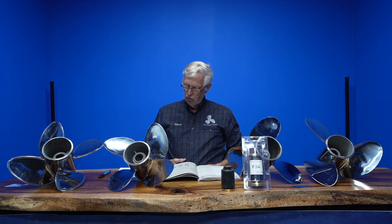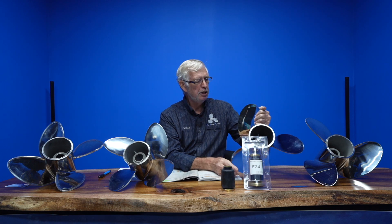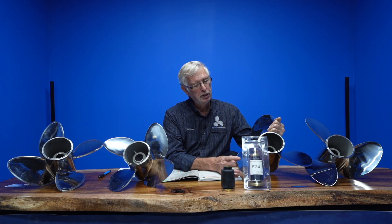These boats predominantly go better with a three-blade — I'll say it again, they go better with a three-blade on those 150s and 175s. You need a lot of torque to push a four-blade; of course you can put a four-blade on it, but whether you'll get the best overall performance is really debatable. Three-blade propellers have been made specifically for those 150, 175, and 200 — especially the four-cylinder 200s. In our range those propellers are called Stellars. There's a 14 and a quarter diameter, and we have an example of that just here. This is a Stellar blade — 14 and a quarter diameter — and you'd put that on a 150 any day of the week. If you step up to 175s and 200s, you can go to the 14 and three-quarter diameter.